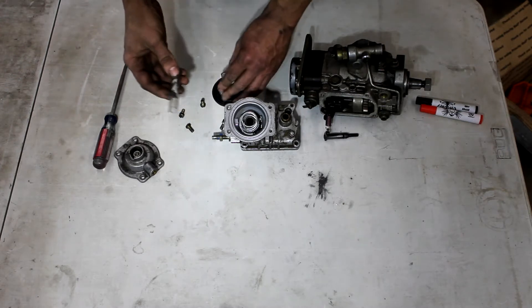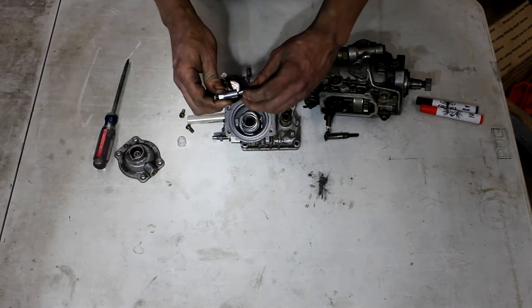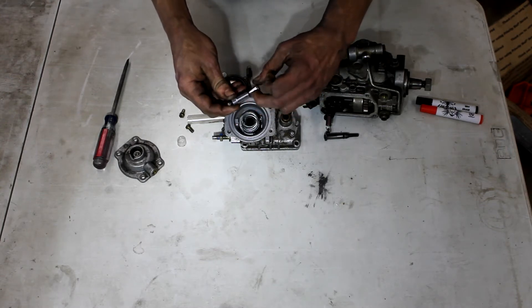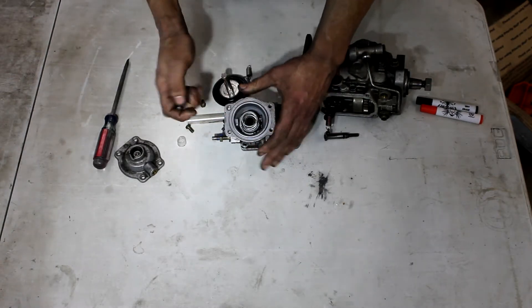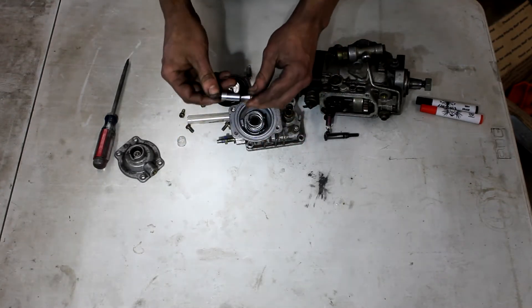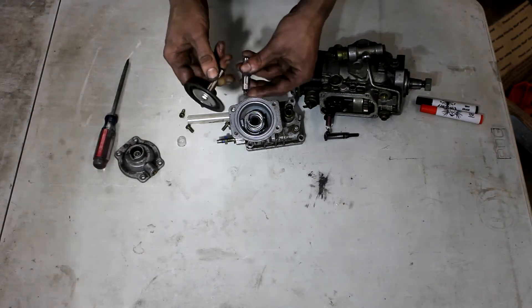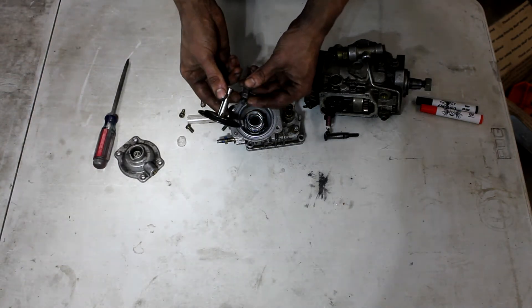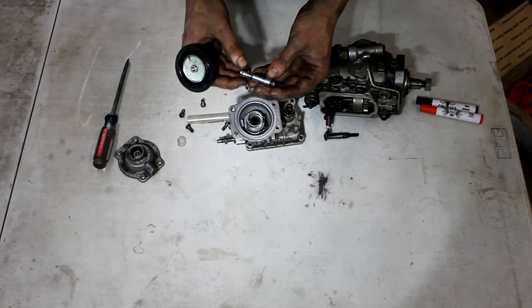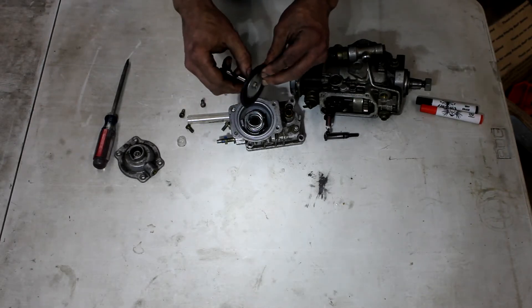This is not the OEM fuel pin - I have an OEM fuel pin right here. One of the tricks you can do is rotate your fuel pin so the deepest part of the taper is farthest away from the pin inside, which allows the pin to travel farther and the fulcrum lever to also travel a little bit farther. There's a nylon spacer right here - a lot of people like to shave them down, but just take it out. It doesn't make a difference and won't hurt anything. When you run a Denny T fuel pin or any other aftermarket fuel pin, just take the spacer out. You don't need it.